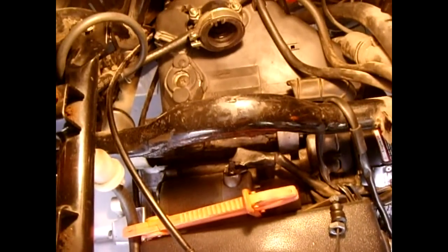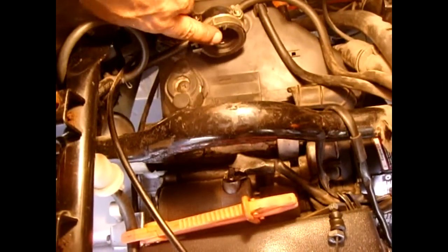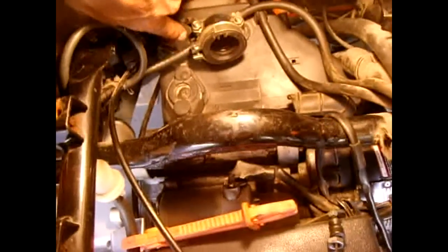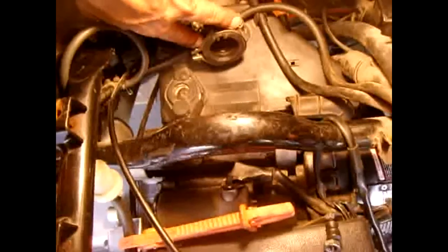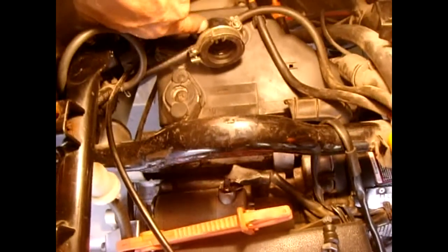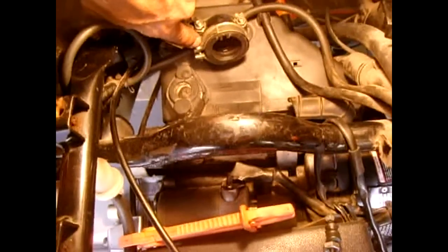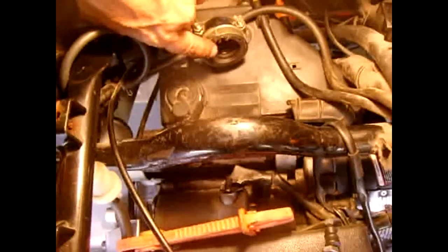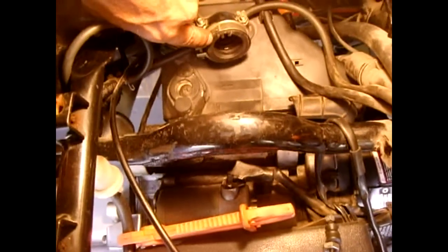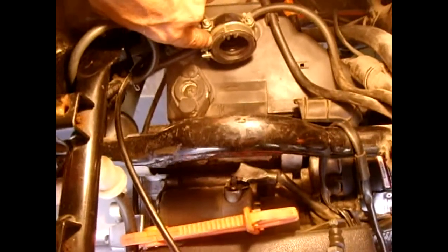You're looking at the area where the carburetor has been removed. Over here is the intake manifold elbow. It's best to take off these two bolts — one there, one on the other side. Inspect it, make sure it's not cracked. Make sure the O-ring that's bolted to the head is in good condition, and if you're not going to unbolt it, at least take a flashlight and look inside to make sure there's no cracks. If there's any hairline cracks, the engine will not run right because you're going to have a lot of vacuum being lost from this elbow.